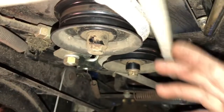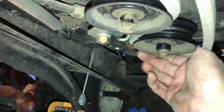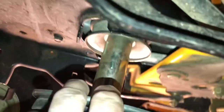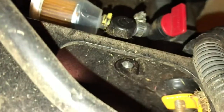I got the new belt in - I had to unbolt this pulley here, drop the pulley down so I could put the new belt through since it was a tight fit. That's ran through there so when you push the pedal it pulls that tight which then pulls the belt tight. The only thing left is to bolt this guard back on and put the battery in. The guard bolts back up to that hole, and there's one on the other side. I already got the engine mounted back on. Before you put the guard on, make sure to put your deck belt back on unless you're going to be taking the guard back off.